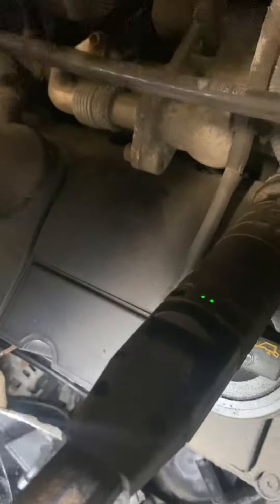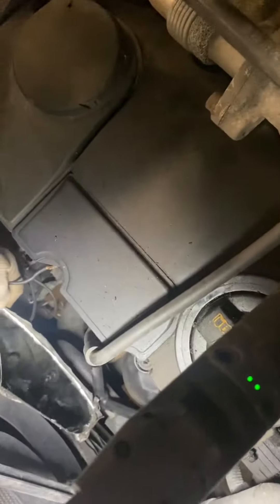On these you're probably going to have to use a mirror, so get a mirror and do it that way. You can see the glow plugs — it's a little bit fiddly, but it saves you breaking a glow plug off in the cylinder head. On other vehicles you can get to them really easily and you can see exactly what you're doing. Quick tip.